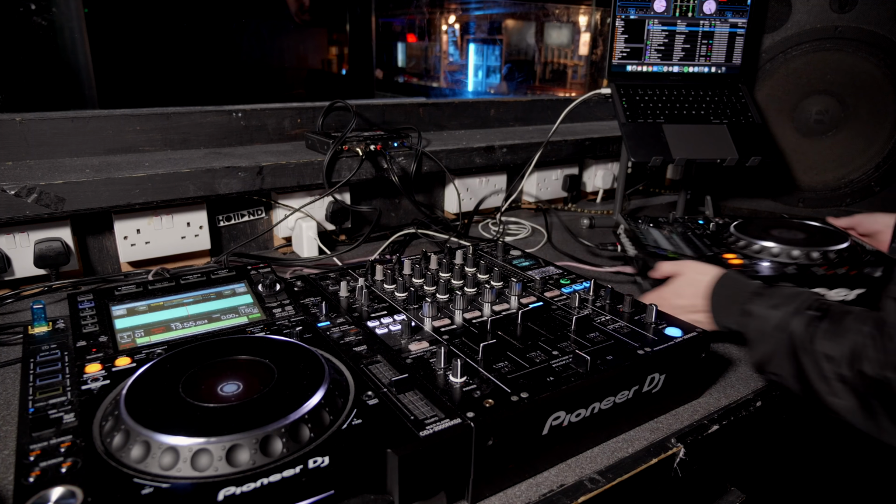It's worth noting, however, when we're on the back of the mixer at the moment, that the line input on the back of most DJM mixers is, if you're looking at it from the front of the mixer, on the left hand side of the pair. So on most DJM mixers, your channel will come up and then you'll have your two inputs for that channel just at the top of that channel.